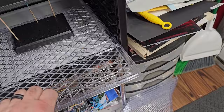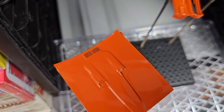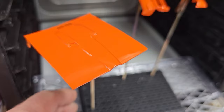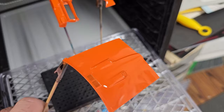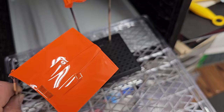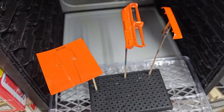Setting that down, let's take a look at the hood real quick. The hood painted out really nice — you can see that panel line in the back, that's pretty sharp. Same for the bumper and spoiler — painted up pretty good. This has been sitting about an hour, she's just starting to tack up nicely. The bottom is probably pretty good but I'm not going to start handling it.